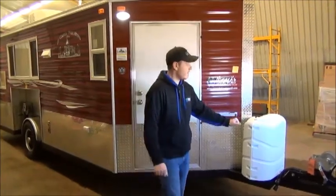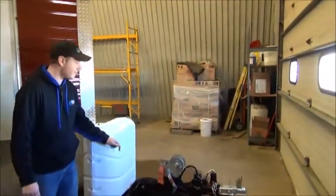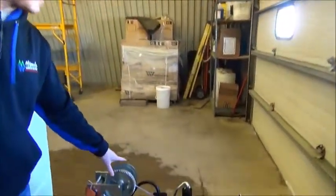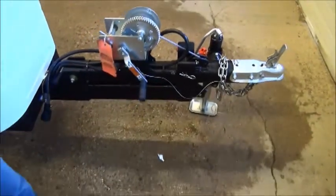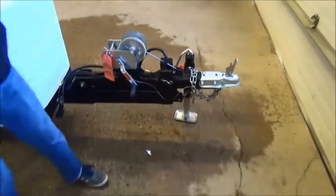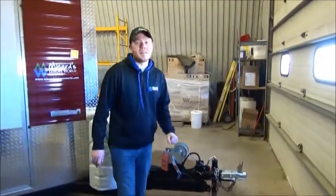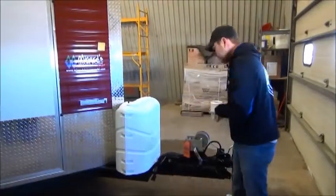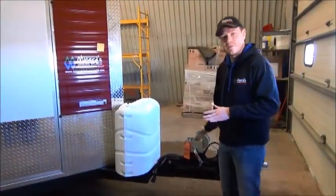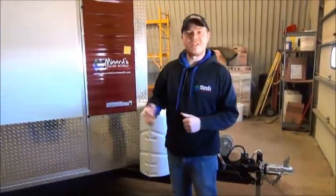Now looking at the front of this trailer, you're going to see a kind of funny mechanism — I'll explain that. We've got a winch system. This allows you to drop the trailer flat down onto the ice when you're ice fishing. You can actually leave it coupled up to your vehicle when you do so, and it's easy enough that you can do it just by yourself. Once you've unpinned it, you can drop the front tongue jack down completely and then do about 10 turns per side at the wheel wells.